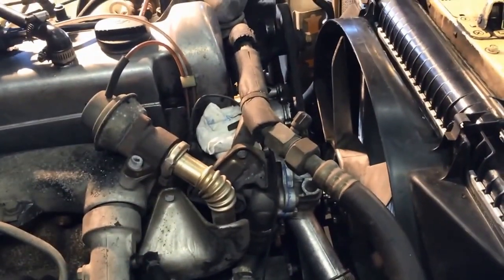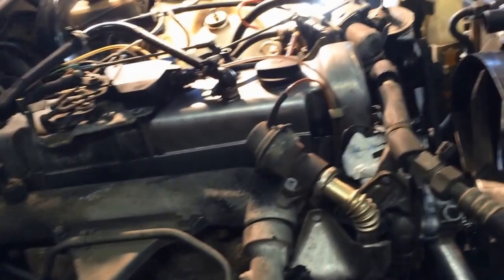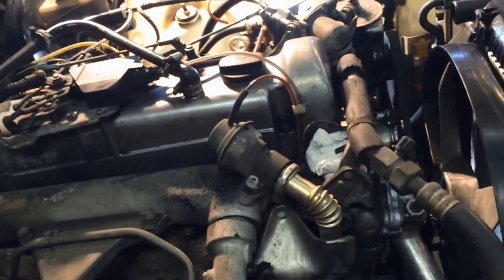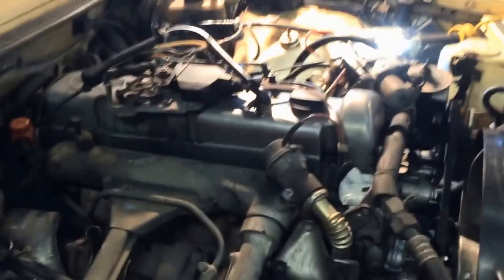So, pump's on, thermostat's in, fan clutch changed, MonoValve done. It needs a valve adjustment. It needs a lot of little stuff. It needs work. I mean, I'm surprised it runs as good as it does for the amount of stuff that needs to go back into this thing. We're gonna put some coolant in now. We're gonna hook all this back up. All I gotta do is put on the upper hose. So in the next video, you'll probably see it running, or you'll at least see it completed.